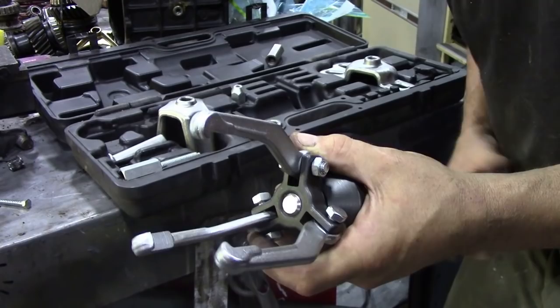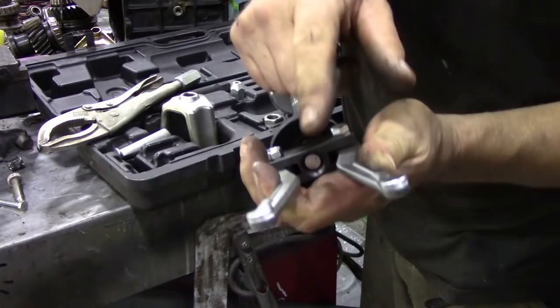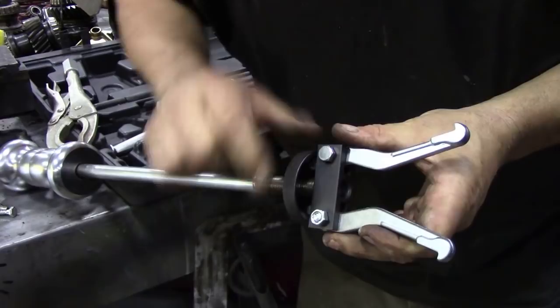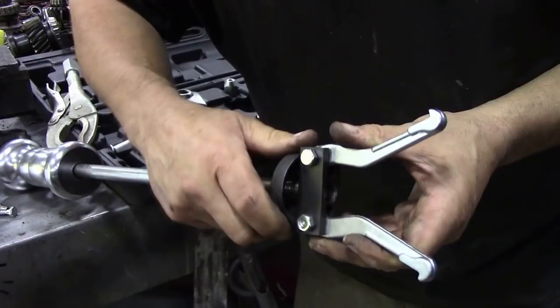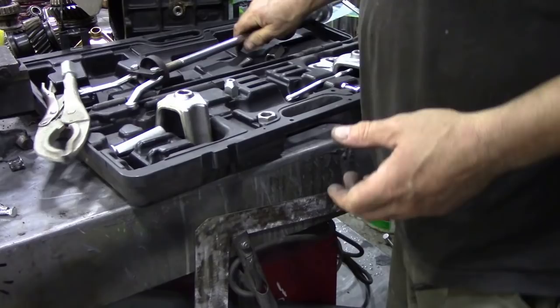But what if a bushing is stuck on the inside? Say you've got a bush or something hollow that you need to pull out. You set the tool like this — you've turned the cone the other way around — and that will open the legs tighter so they're really gripping inside the tube. It's infinitely adjustable. It's a great piece of kit; I wish I'd invented it myself.